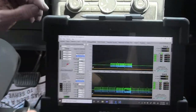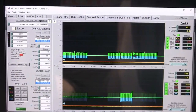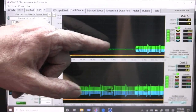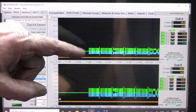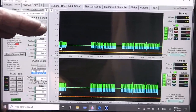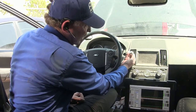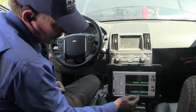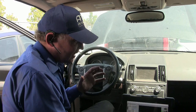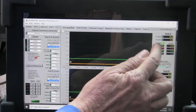Now I want to make a point: this isn't medium speed in the traditional fault-tolerant sense — this is CAN high speed being used to provide the medium speed. Notice that the recessive bit, or bias voltage, is at 2.5 volts, and then I'm going up a volt and down a volt from the 2.5, so I'm going to 3.5 on CAN high and 1.5 on CAN low. That bus is functional, so the low speed bus is working. But when I activate the button, the low speed activates while the high speed is dead — it's pulled down to close to zero. The high speed bus seems to be grounded.